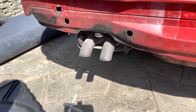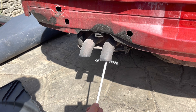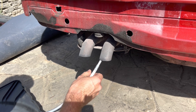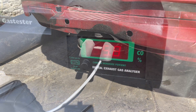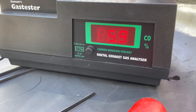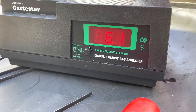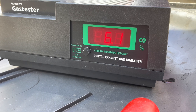You need a minimum of eight inches — about 20 centimeters — of probe insertion. After waiting a minute post-insertion, the figure has been stable for at least 20 seconds: 5.96%. That is very high. So I'm going to try to lean out the mixture on the ECU and see if that brings it down.